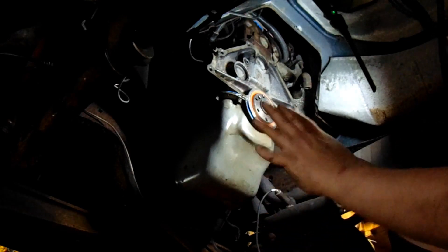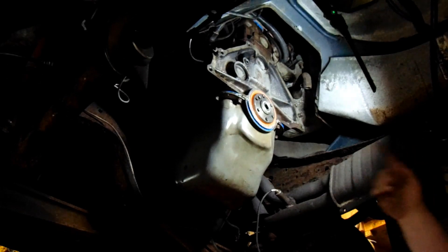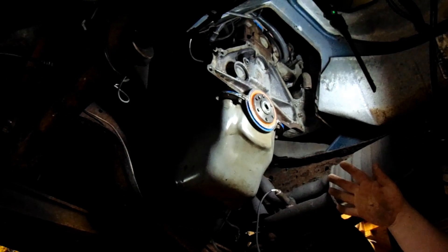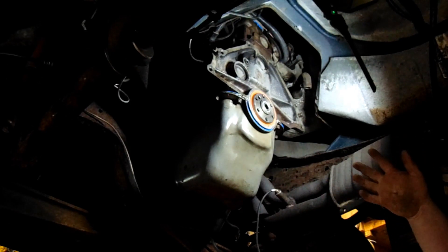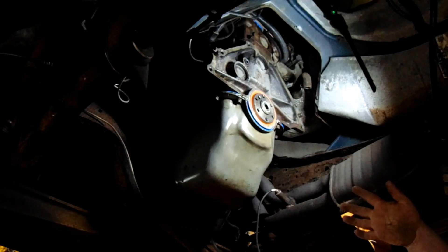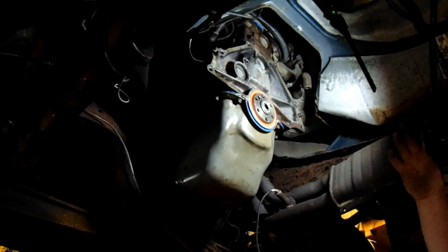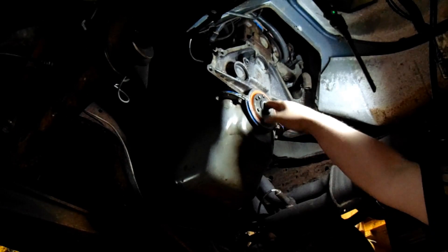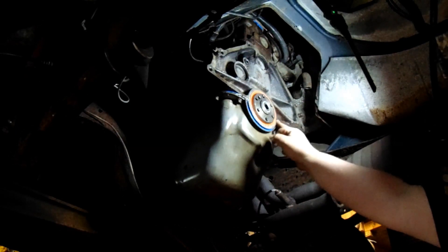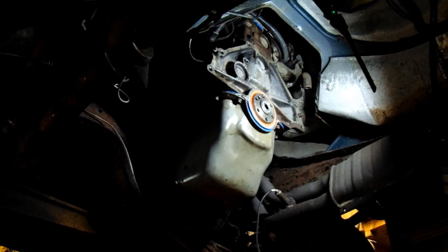Okay YouTube, back under here. I can do jazz hands now — I got a tripod. I'm usually the only tripod in the garage, so this is going to take some getting used to. I'm usually not that serious with my shit. I'm just some guy stomping around his garage, cursing a lot, holding the camera. But anyway, I got the clutch. New pilot bearing. New rear main seal. Little RTV in the corners from the oil pan gasket. She's ready for the flywheel, clutch, and transmission.